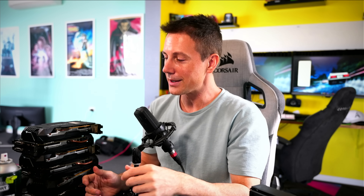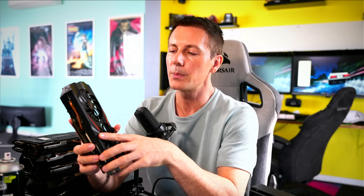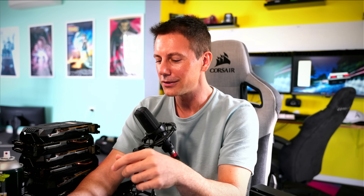It just needed to prove a point that if you wash PC parts, get all the water out straight away, then re-lubricate them - there is going to be nothing wrong. Now there was another comment saying these things are going to dry out very quickly and be useless in maybe a couple of weeks to a couple of months. I've been doing this with ultrasonic cleaning and multi-purpose spray for years, selling PCs with these refurbished parts, and none of the PCs come back with that complaint about the fans not working anymore. That's real feedback from the real world. I know it works absolutely fine. I think it was around 2015 we started doing these sort of really unorthodox methods of cleaning and getting good results - so this goes way back on Tech Yes City.